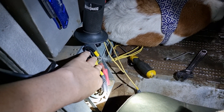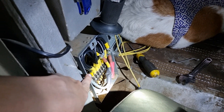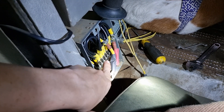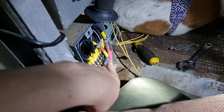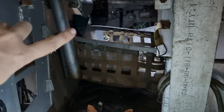So we're inside the tank. Specifically I am inside the driver's position and I am working on the hull junction box for the RBJ. Essentially what this does is it connects to the turret rotary base junction which is behind there. We're connecting up the power from the distribution infrared distribution box which is that grey box right in the back there.